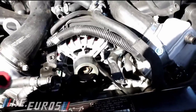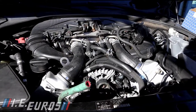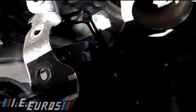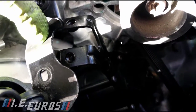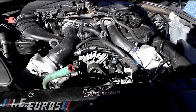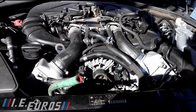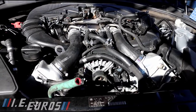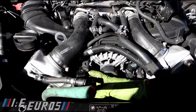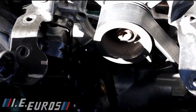With that we have another issue — right here, see, we don't have enough clearance to relocate the pump where it goes. The correct way to fix this problem is to replace the radiator hose and then we would be able to do it the proper way. But we are fixing this car on a budget — the owner doesn't have a large amount of money to fix it. So we're going to do something to work it out. Also the belt is too close, so if the hose hangs there it can get cut through by the belt and damage something else.